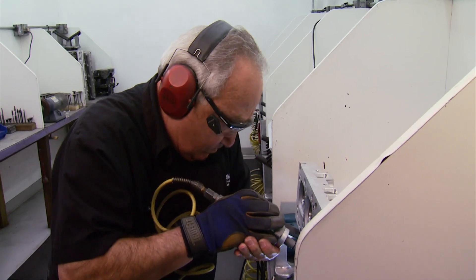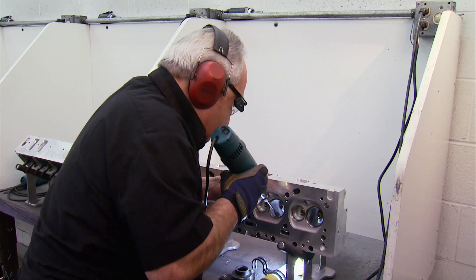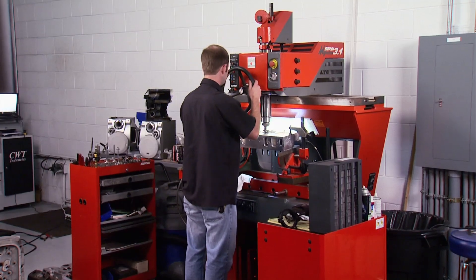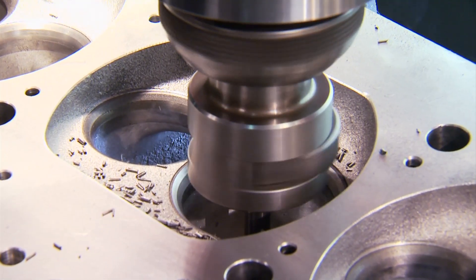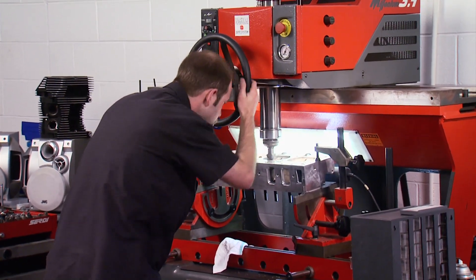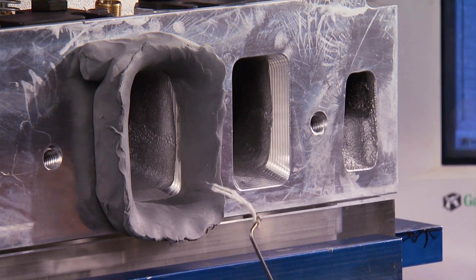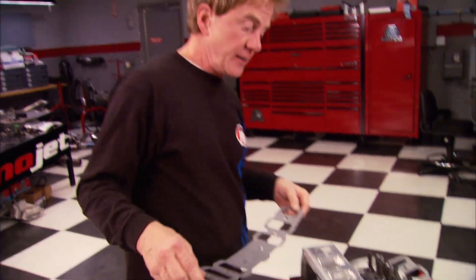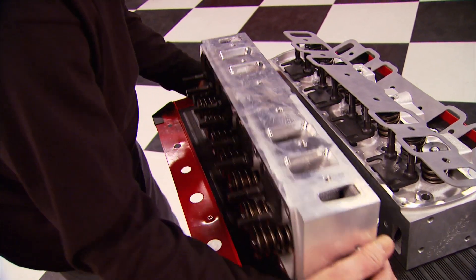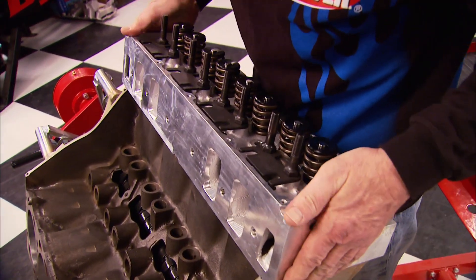These guys don't allow any heads to leave the building without a little tweaking — roughing out the combustion chamber valve pockets and polishing them to a smooth finish. These heads are ready to use right out of the box, but a three-angle valve job is assurance the valves will seat well and flow freely on the flow bench and when installed on the motor. About the only thing we could do to these heads is port match the gaskets, but they're dead on. Gasket's on, and so's the head.